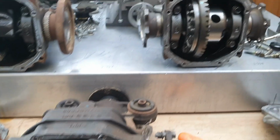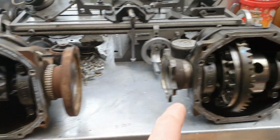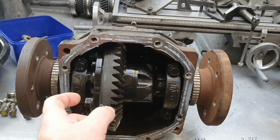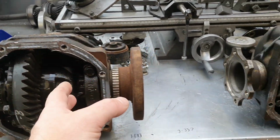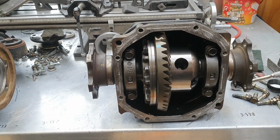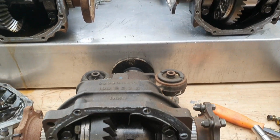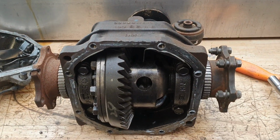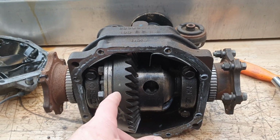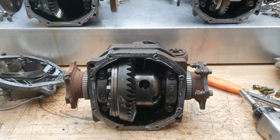And fortunately, when I was looking at this going, oh, these gears, they're not going to work in here because this face here is 10 millimeters different between here and here. So there's absolutely no way our crown wheel and pinion's ever going to line up. It won't work. Boo-hoo, how am I going to make my drivetrain work? And then I was like, hang on a minute, you've got an auto diff kicking around in the house. They're a different ratio. I bet you they've got a different setup in there. So when you pulled it out, there's your answer right there. So that's that problem solved.